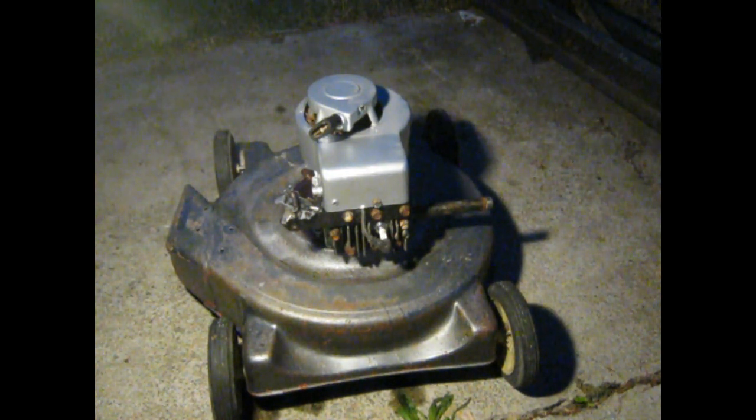Once it fires, it will develop a vacuum in the chamber to suck the fuel mixture in, but initially there's not much exchange and it's pretty hard. I mean, I could fill the intake manifold with gasoline by accident. I guess the only other way to put some fuel in the chamber would be through the exhaust. Unfortunately, I can't remove the spark plug.